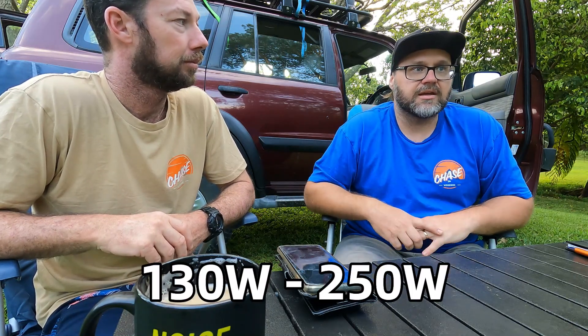For panel size, I wouldn't worry about anything smaller than about 130 watts — it's really not going to be too beneficial. Up to 250 watts is a good size; some brands do portable panels at 250 watts, which is great for longer trips as you'll have more power going back into your battery. For weekend camping where you're parked up for a couple of days, 130 to 160 watts is a good size. You've also got different types — rigid folding portable panels, solar blankets you lay on the bonnet, or ones you hang up.